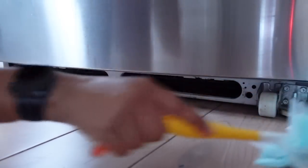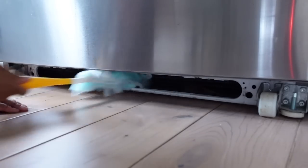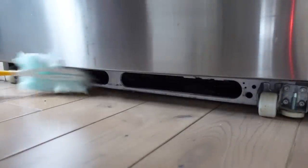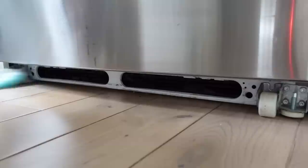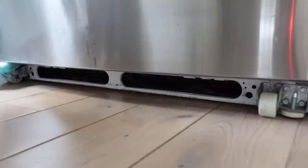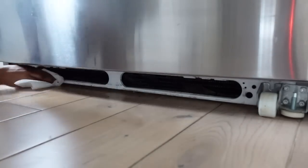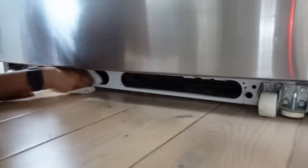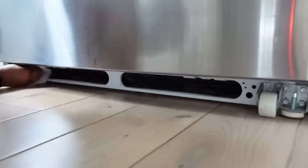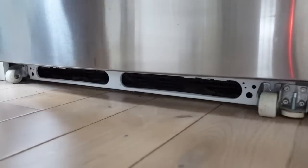I went in there again with my Swiffer, which picked up a lot of the stuff left by my vacuum — stuff that was just stuck to the condenser coils. It's really good to do this once a year, maybe more often if you have pets, because a lot of that hair gets up in there and the condenser coils can't work properly and your refrigerator can malfunction. You might notice things like the fridge temperature not being as stable. So it's important to do this every now and again just to get all that dust out so your fridge can work as it's supposed to.